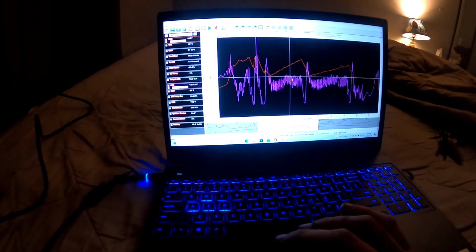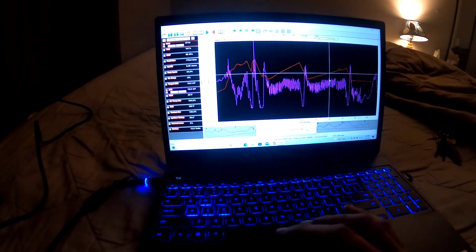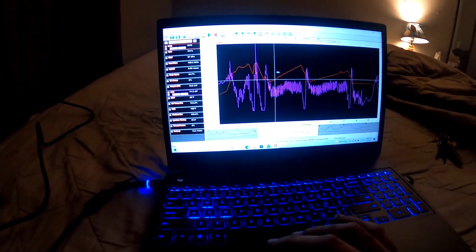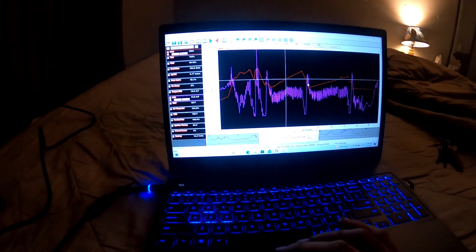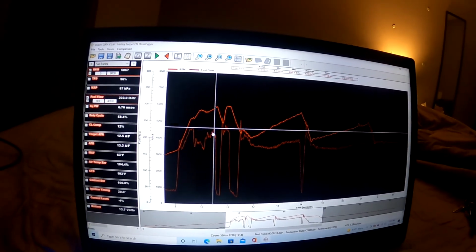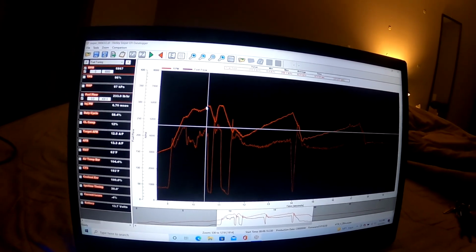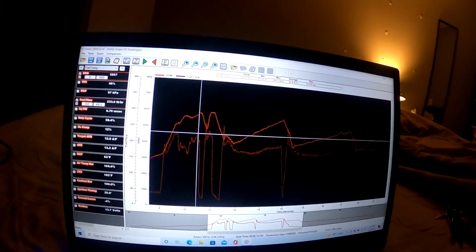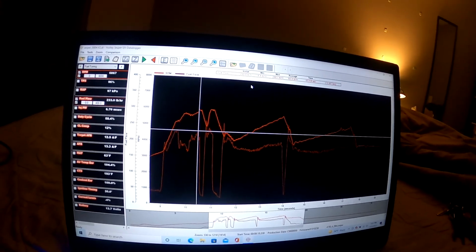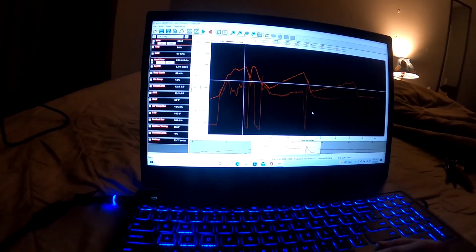And it looks like the fuel, let's see where the fuel hit roughly the maximum. So it looks like under wide open throttle, we reached a maximum at like 6,000 RPMs, more like 5,700. We reached 233 pounds per hour, which, if this is accurate, is around 450-ish horsepower. So that's pretty cool.